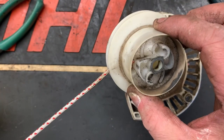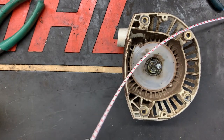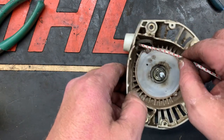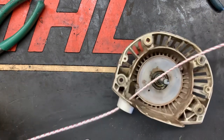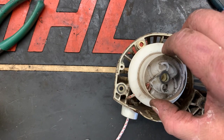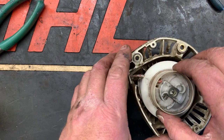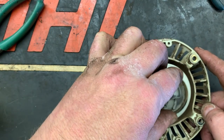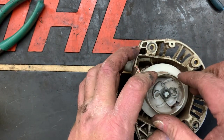So you've got your rope rotor with the rope installed. Take the rope, drag it all the way across, set it to our right over here, and make sure you put the rope through the eyelet. Then set the rope rotor back down onto our starter, and make sure it engages with the spring — just turn it until it pops down, just like that.